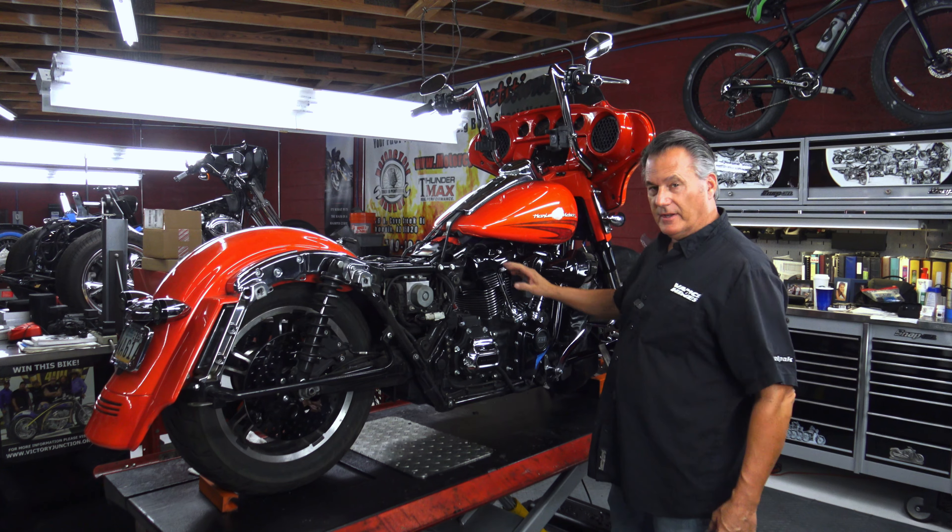He also explained to me he put roller rockers in and it actually got louder, so that kind of gives me an idea of what path I need to go down to maybe fix this. But we're going to go through and more or less measure everything and make sure it's nice and tight. I am told he did have an S&S oil pump put in this, and I'm not sure about everything else in the lower end.